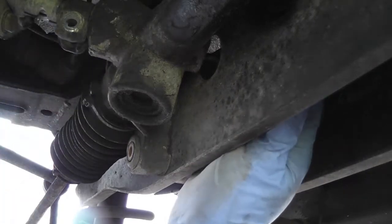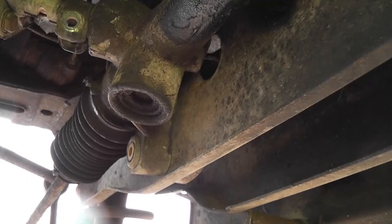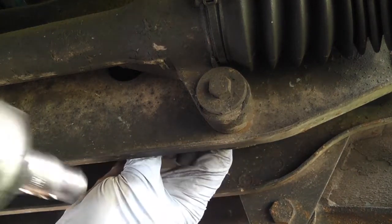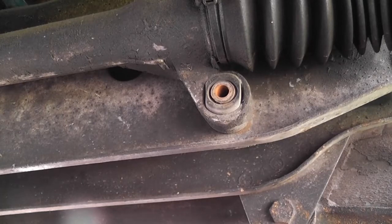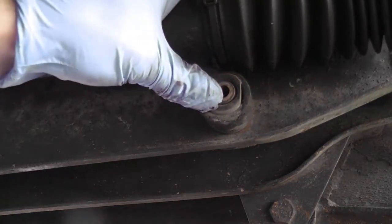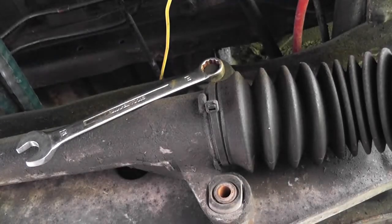They're stitched in. It would be prudent to spray them with a bit of WD-40. I'll get some WD-40 on them and pop them off with a ratchet spanner. All four bolts are out now — the two top ones were absolutely seized and quite badly corroded. The bottom ones came out easily only because I have an impact gun, but I couldn't get the impact gun square on the top ones. Ratchet and spanner with liberal application of WD-40 it was.